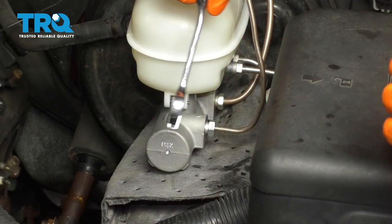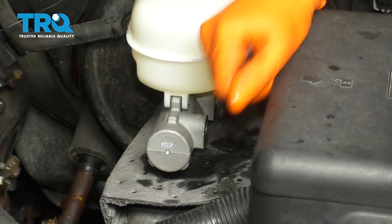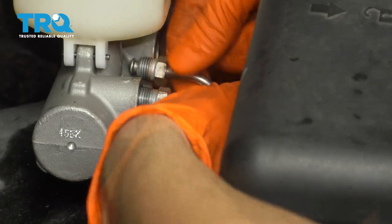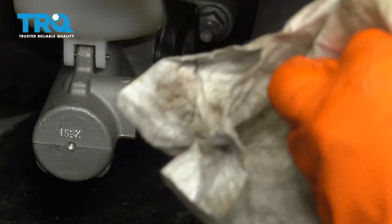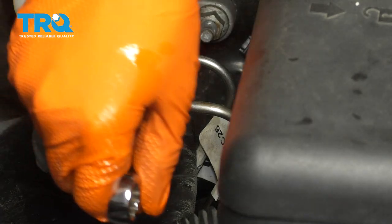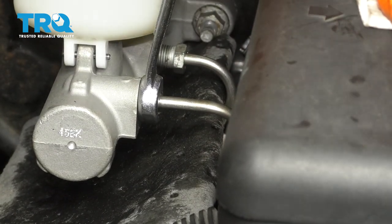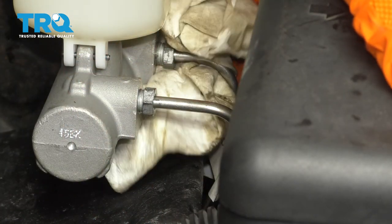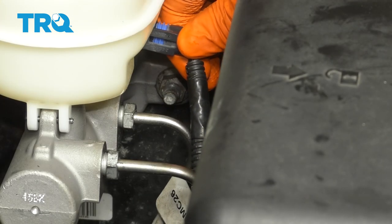Go ahead and break these lines free. There's one line — take the other one off. Now you can take your actual brake lines and connect them in. Make sure when you start the fitting, it doesn't cross thread. Sometimes it's a little more difficult to do this, but just be patient and make sure the threads are started on properly. I used my rag so I can get a little better grip on this brake line. Snug this one up completely, make sure it's nice and tight. Obviously, don't strip the threads. Do the same to this rear one — make sure it's snug as well. Don't forget to connect your level sensor and make sure it clicks in.